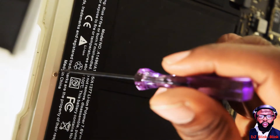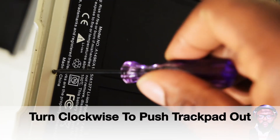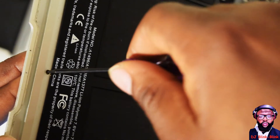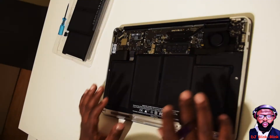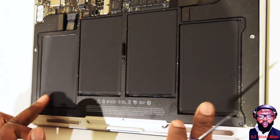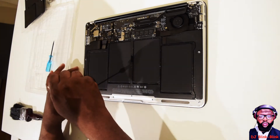For those who want to learn how to adjust the clicking, there's a screw here. When you tighten it clockwise, it pushes it out and you're good to go. Turn it anti-clockwise and it loosens it out — and you can hear that clicking. Brilliant, the clicking part is sorted. Now for the battery, there are five screws to remove. I'll put the screws in this plastic tray and we'll crack on.